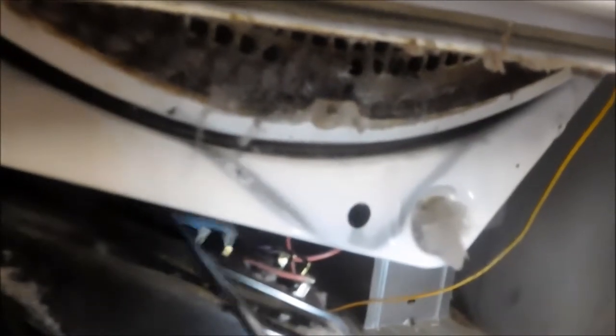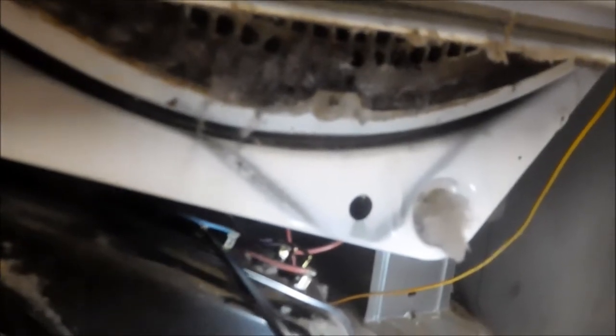It's a non-resettable fuse that has to be replaced if it's burnt. Basically we're simply looking for continuity on that unit. The unit is unplugged — otherwise I wouldn't be doing this like this. Basically what we're trying to do is find if we have continuity between this terminal and this terminal. I'm isolating it from the circuit just to be double sure we're not getting any reading from the circuit. If we have continuity, it's going to be on the heat element, or there's a thermal cut-off on the heat element as well.